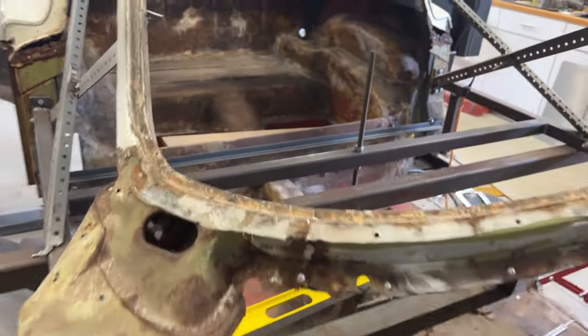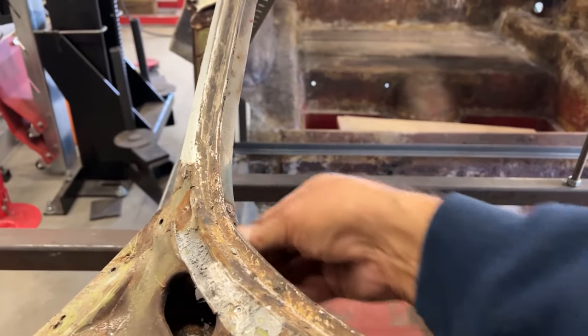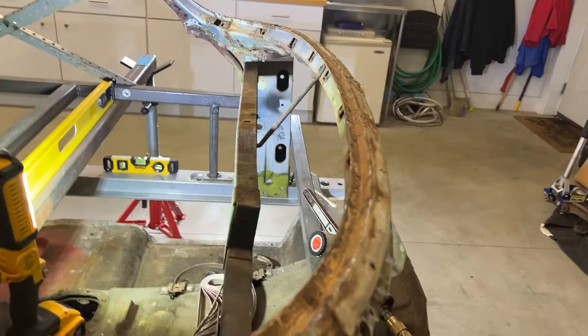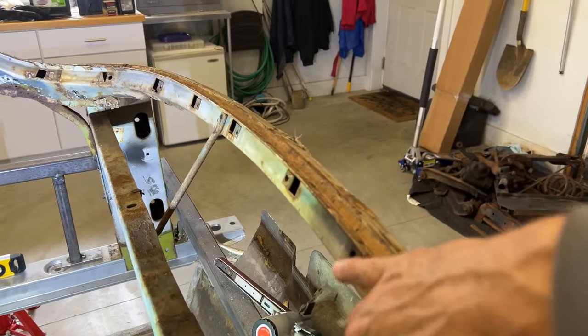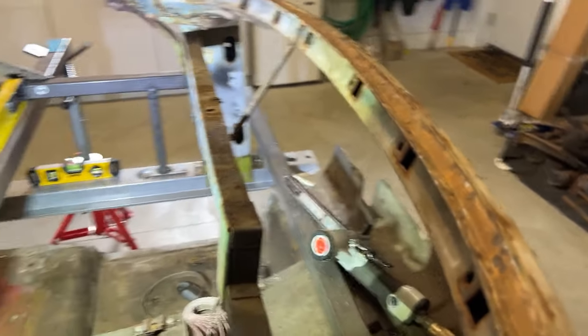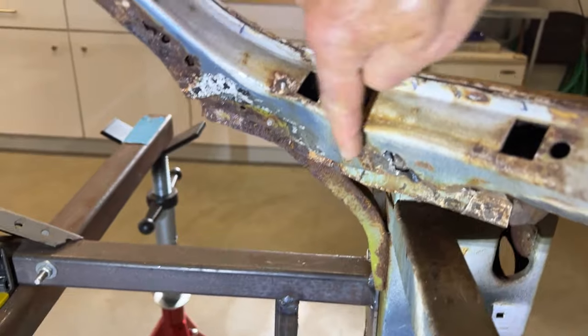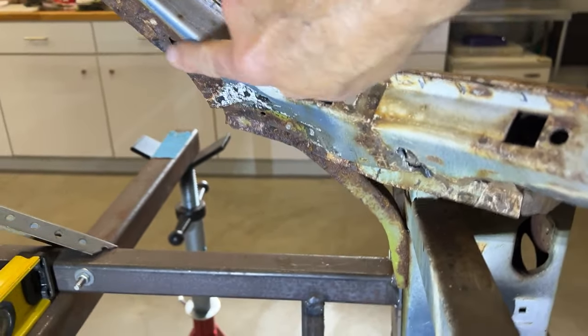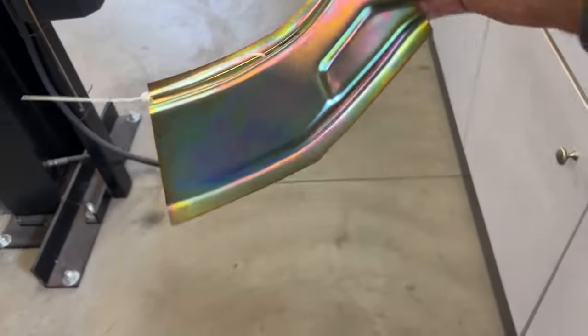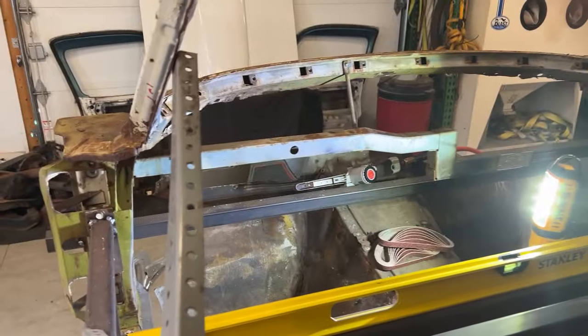It looks like I might be buying the inner portion of this lower rail. I may not replace the whole thing up in here, but I may use parts of it to replace what's rusted. I'm going to start working on this lower windshield inner panel - it's got some rust here. I also want to access this area right here because I have some pin holes. Here's the new panel - all new - so I'm going to use a portion of that to replace it and get some nice solid metal in there.